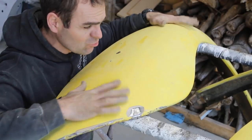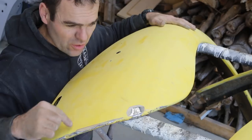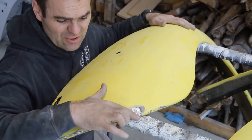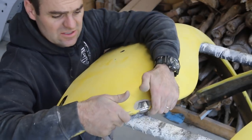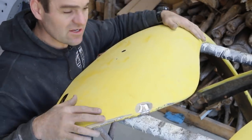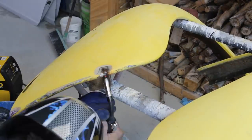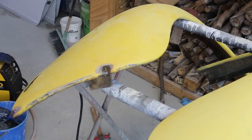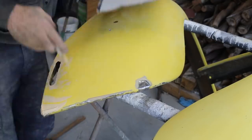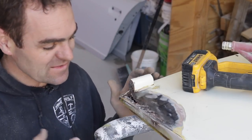I've been getting in and just doing the final tidy up on all these parts and I noticed on this particular back guard, there are a couple of little corners where the panels are split. Looks like there's actually been some small damage here in the past that's been repaired but not very well, and the metal has split. So what I'm going to do is bend it back out, weld it up, and do the final bits of filler to get all these bits ready completely for primer. This car just keeps giving such wonderful gifts.